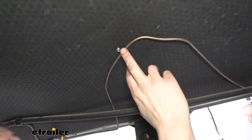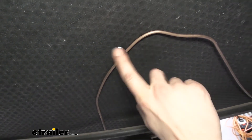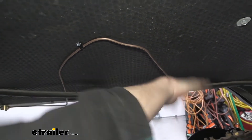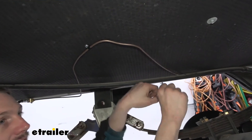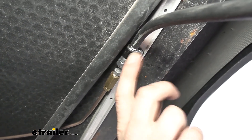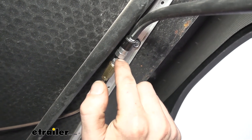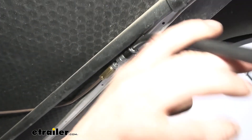Also included with your kit, you're going to receive some hardware to help you get the lines routed. You'll receive some small plastic clamps with self-tapping screws, so you can run these into cross beams and down the frame as you're routing your lines. It's important that those are secure because if they have too much flex, if you've got a bunch of bouncing going on, it will eventually break the metal line. If you've ever had a spoon and bent it back and forth, eventually it breaks — it can be similar if you're bending steel that way. You'll also receive some larger clamps for your flexible hoses to hold those in place, and that just helps to prevent movement in the small, solid metal section. We want the movement to happen on the flexible portion.